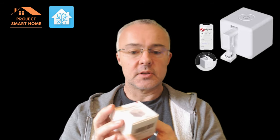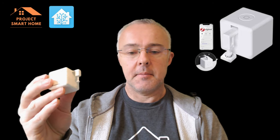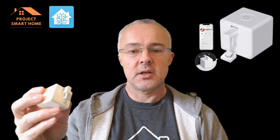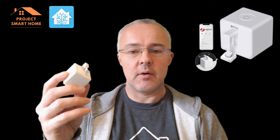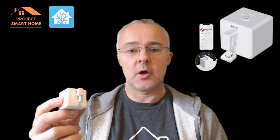I bought myself a FingerBot to enable me to switch on and switch off my dehumidifier. It's a pretty straightforward device, but the problem I've got is my air conditioning unit has one of these buttons where you need to touch it with a human finger to turn it on and off — it's a capacitive button. So in this video I'm going to show you how I've got this device set up to work with that capacitive button and how I integrated it into Home Assistant.